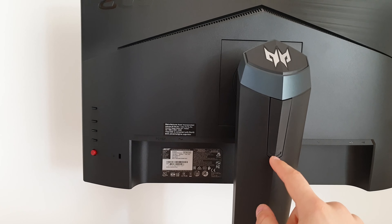There are a few different textures used — mainly plain matte black plastic and also a brushed textured matte black plastic used elsewhere. There's a Kensington lock slot and the ports are down-firing — some to the left of the stand and some to the right. There's also a quick release button for quick removal of the stand, which reveals 100 by 100 millimetre VESA holes for alternative mounting.